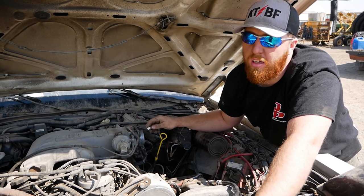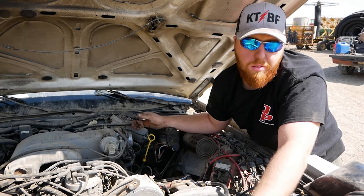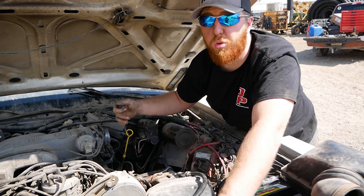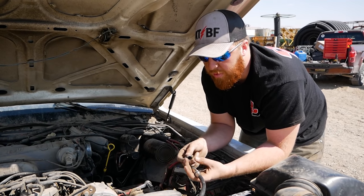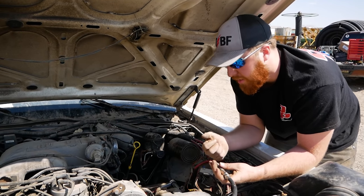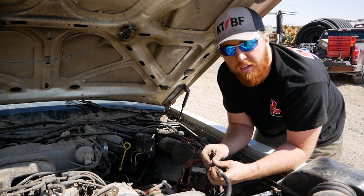And that's why fuel injection systems are a little bit better than a stock carb system. Well, arguably way better. They handle heat better than a stock carb system because they return fuel to the tank and flush out that hot gas. Basically, if you're not getting fuel, follow that system backwards or start at the back and work forward. It's either gonna be a pump, a filter, a pressure regulator that might be bad, letting all the fuel run back, injectors might be clogged, blah, blah, blah.